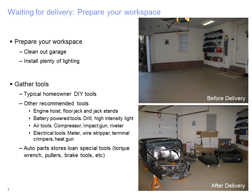that's even better too. But still, an air compressor is helpful, particularly with an impact gun. They still are more powerful than the electric ones. And in particular, the car that I built had something like 1,200 rivets, so an air riveter was really the reason I bought the compressor. And that saved me some carpal tunnel syndrome on my wrists.